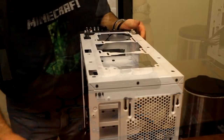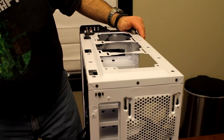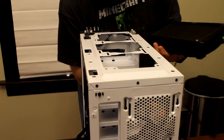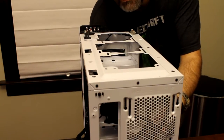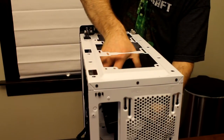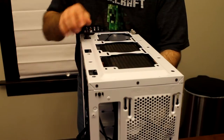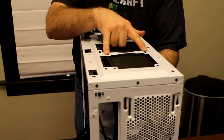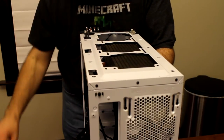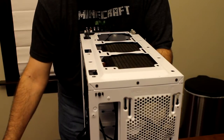Okay, here's the top of the case. I'm going to try to get this in here without having to fight too much while recording. I'm going to lay this radiator right up underneath here - it goes in these slots here, here, and here. It almost looks like I have enough room for another 120 millimeter fan over here so I might even try to do that. For these it takes the short screws and a washer.